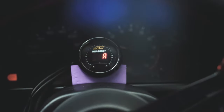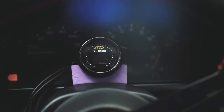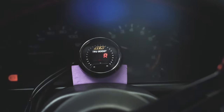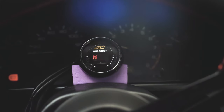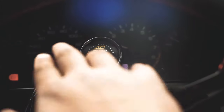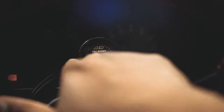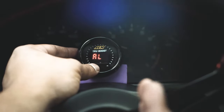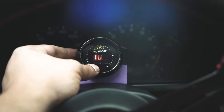This is your alarm threshold — the point at which you want things to alert you. It will go red so you know to back off from the boost. Because I want to run 10 PSI, you should typically set it at 11, but I put it at 10. So when I see the alarm, meaning I've hit my full boost, I back off.